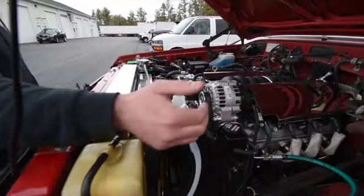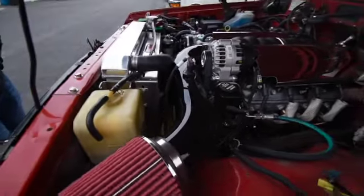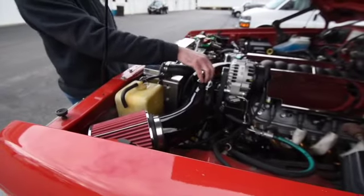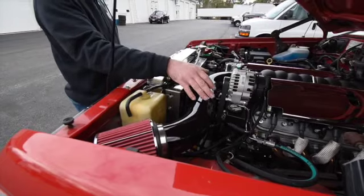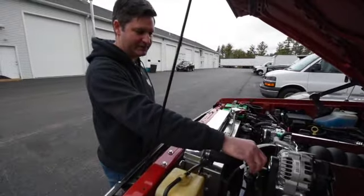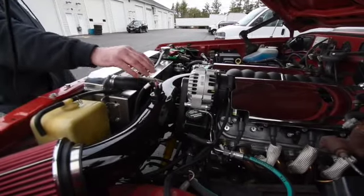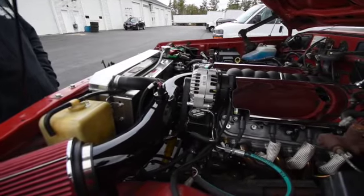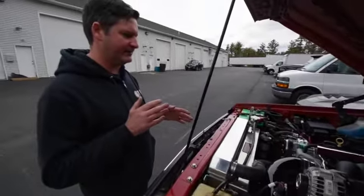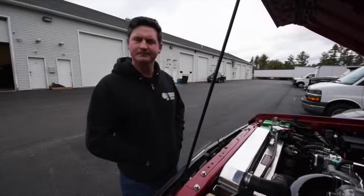It's the tubing and how the airflow through this tube affects the dynamics and the calibration. How do you think we did on the tubing? It's custom made. It looks great. Having it in the middle of an eight-to-twelve-inch piece of straight tubing approximately three-inch diameter means it should be quite close. And then of course you have things like long-term fuel trims that will kick in and help, especially at steady state. You may feel that calibration is needed especially on transients, like in and out of the throttle.